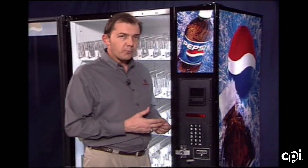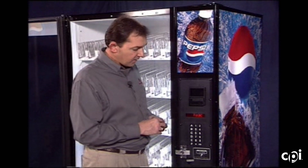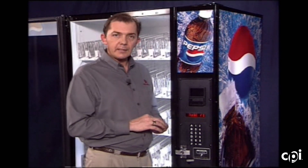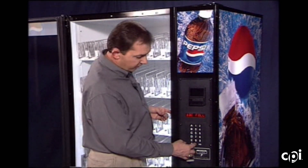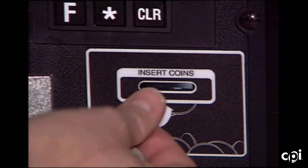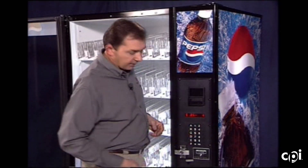The next function lets you go into the tube fill and dispense mode. This is an important feature especially when using a bill validator — the controller doesn't know how many coins are in the mechanism unless you use tube fill mode. By inserting coins through the slot, they're introduced into the coin mechanism, counted, and put into the proper tube. It registers them on the display as you enter them, and you can scroll to dispense using the star key.